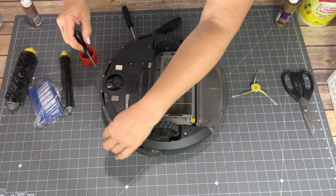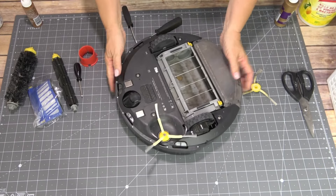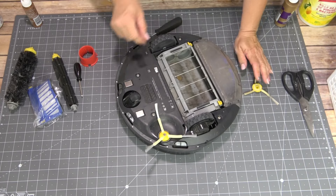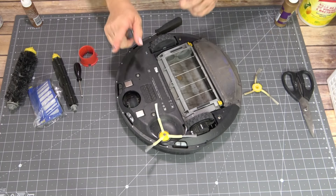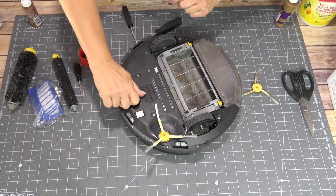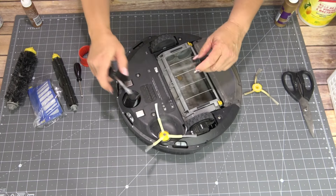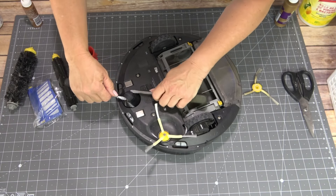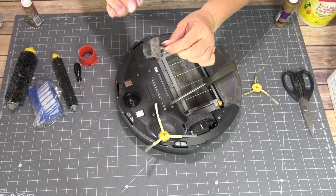This is all pretty basic maintenance, but where it gets exciting is something I just discovered with a client. Her Roomba stopped working completely because this wheel was not spinning anymore. I had had one of these before where all you had to do was pull the wheel and it popped right out, but mine doesn't do that — nor does hers — because there's no way to grab it. Get yourself two small flathead screwdrivers, come near the wheel, don't press very hard, just use them a little bit to get a grip, and start pulling straight up. Did you see that? It pops right out.